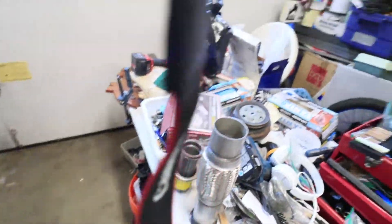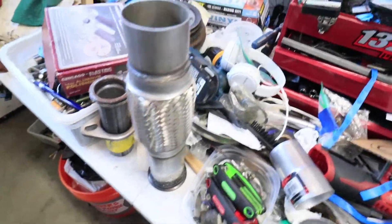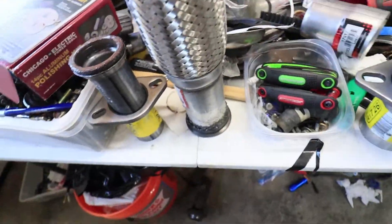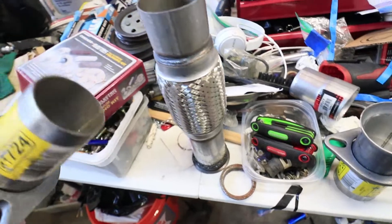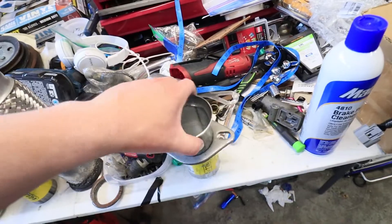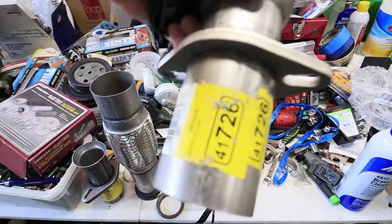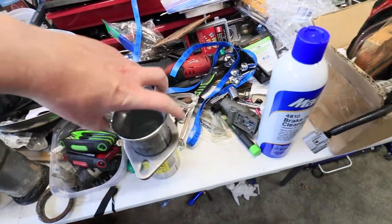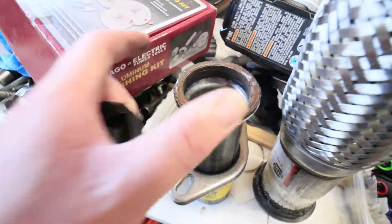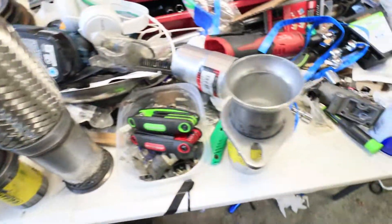What is happening folks, welcome back to the channel. So last night you saw me messing with this exhaust here. Today I got the flanges I ordered in — I ordered two pieces from a company called Walker. One is a 41724 and the other larger one is 41726. This is the donut for my stock exhaust for the CRV motor, and as you can see it fits pretty much perfectly in there. I think this is kind of the fit that you want.